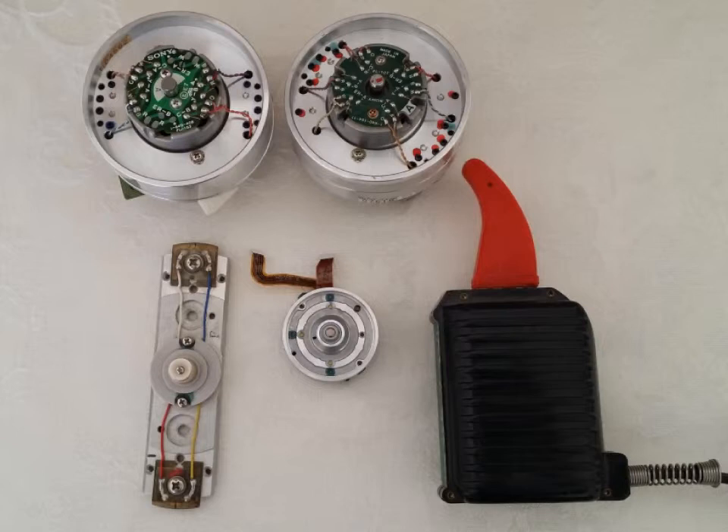As you can see, this demagnetizer has a plastic cover on it with a little lip that points to the very end. You want to take this to all your heads — turn it on, get very close to your heads, and pull out. Do this a couple of times after your video heads are clean. Pull out slowly, and you can actually feel the force — it's demagnetizing your video head. Get as close as you can, have it on, and pull out.